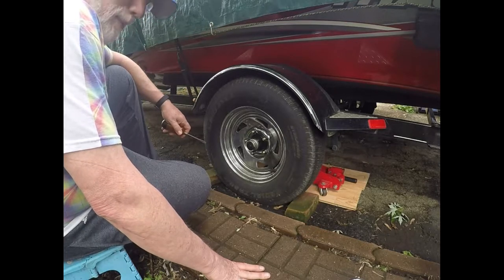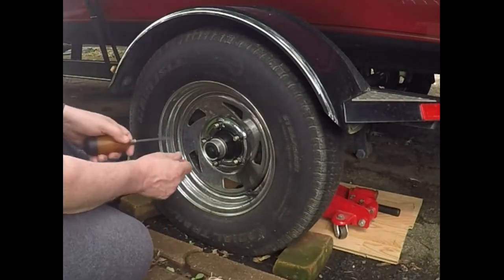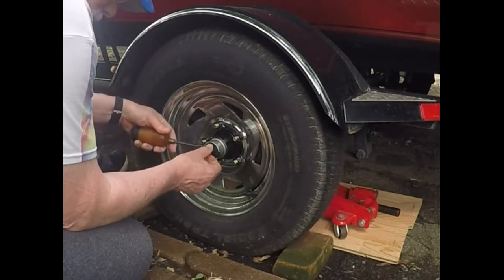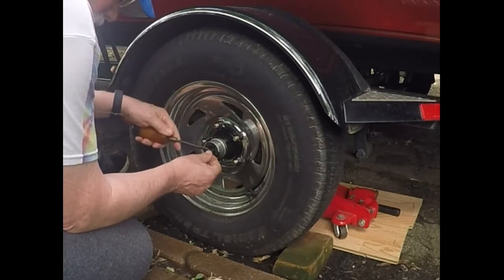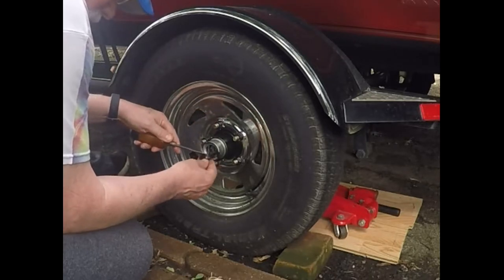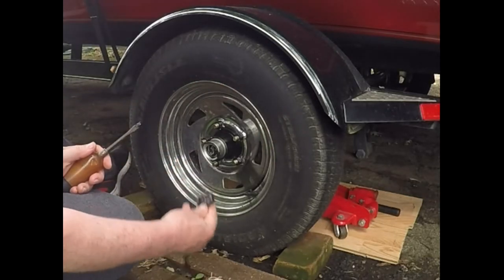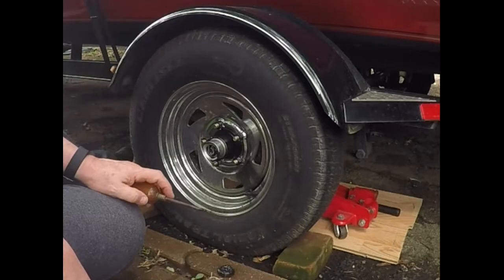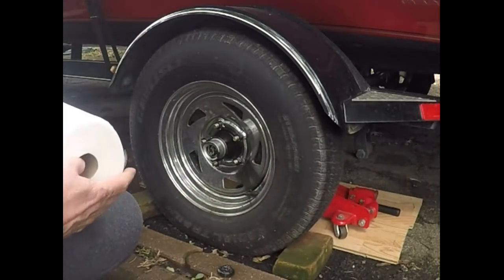The grease heated up and expanded, and that little pop put an edge on this dust cap. So the first step is to take a look at what we've got going on. You'll see the back of the cap is probably greasy, which is okay, but inside there might be just a little bit of excess grease — more than you would normally have in there.